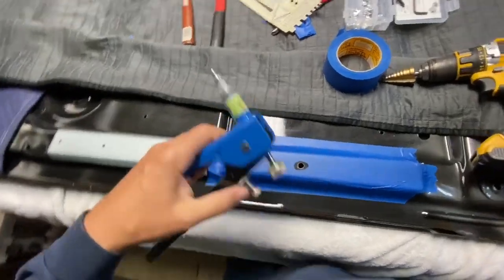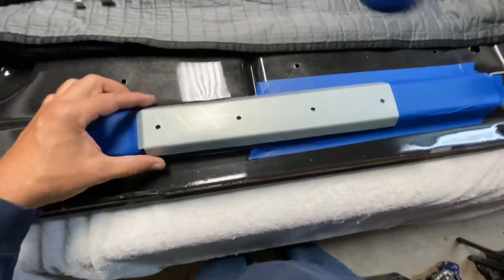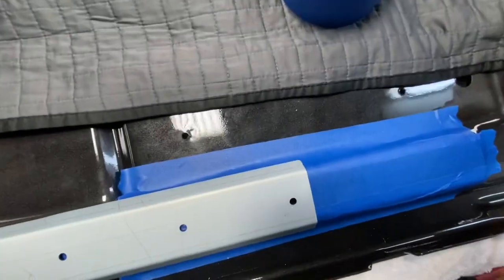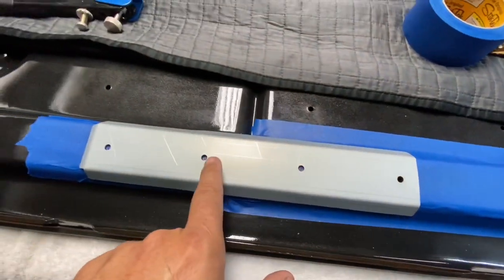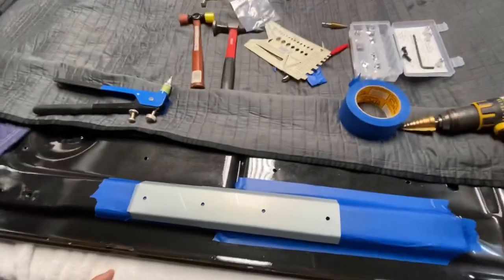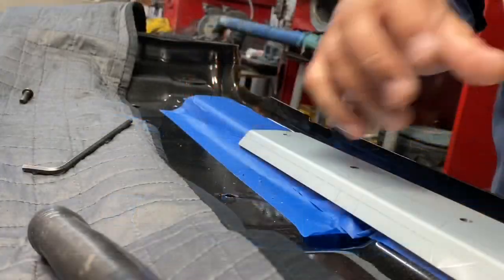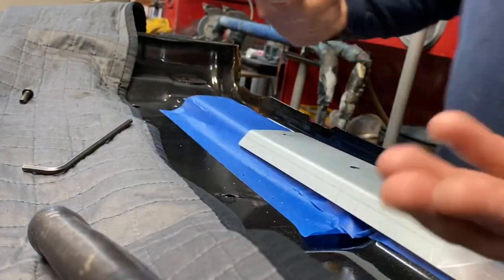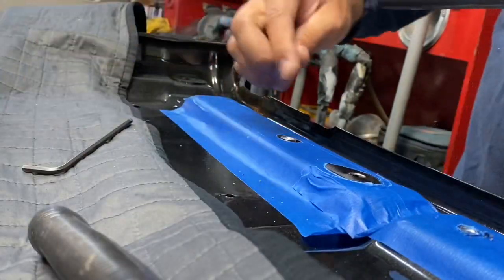So that once you're done with this, then you're gonna go ahead and put your brace on. There's a hole. And what you wanna do is put the nut cert in first, and that will guide you on the rest of the holes to come in perfect, okay? You don't get a second chance here. So now I'll demonstrate how you put this nut cert in. So we got our first one in over here already.